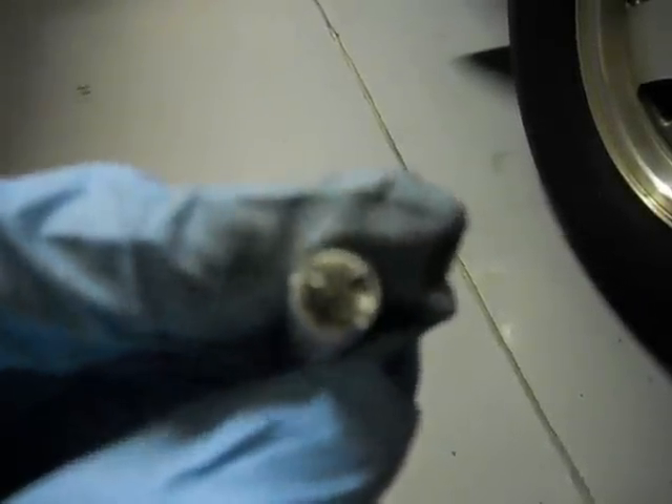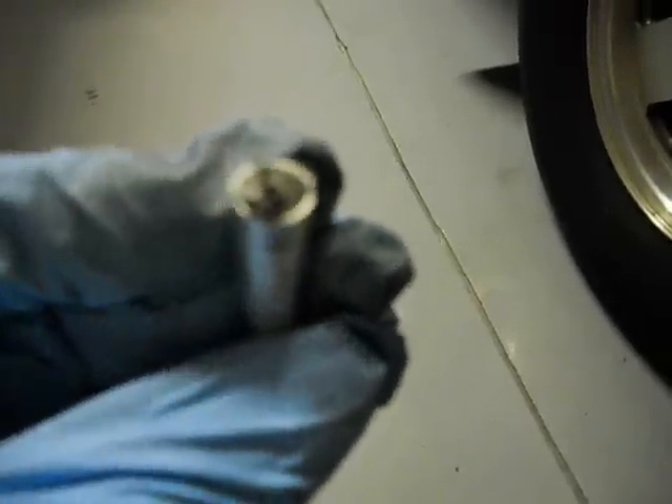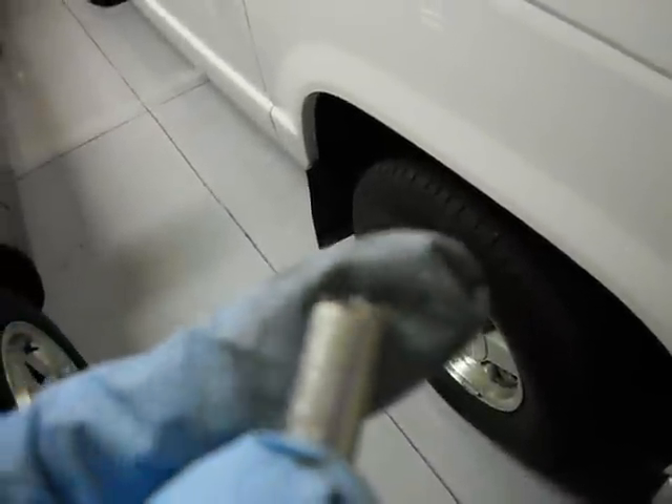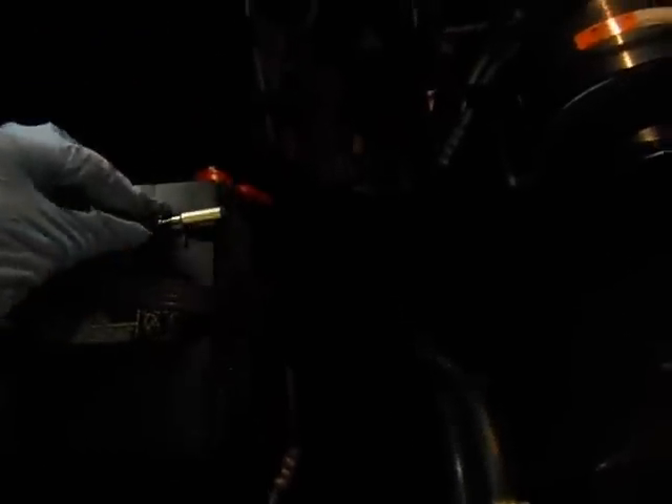That's probably a good thing — it's not bearing material. This is only about a quarter of what came out of this thing. The whole bottom of my catch pan had a good amount. I cut open the filter and there wasn't anything in there, so it wasn't getting through the screen. It seemed like it was basically just sitting on the bottom of the pan, not really floating around.